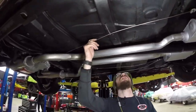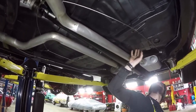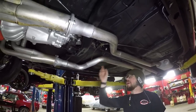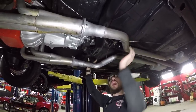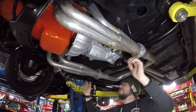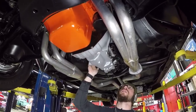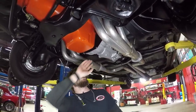The parking brake appears to be hooked up on this car as well. Moving forward, the floorboards look like they're all original — all the original stampings are still there. U-joints feel good, front U-joint feels good too. This is a true dual exhaust system with no H-pipe — just straight out the back. We do have a little bit of patchwork here in the toe board, two minor patches welded in with no sheet metal screws or any ghetto stuff. We do have a Muncie four-speed transmission here. This car being a 67, this is a slightly earlier transmission — by casting number I can tell you it's 64 or 65 vintage, so relatively period correct but a little bit earlier. We do have the GM bell housing as well.